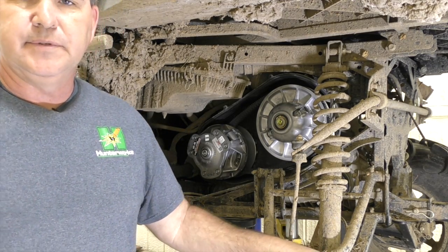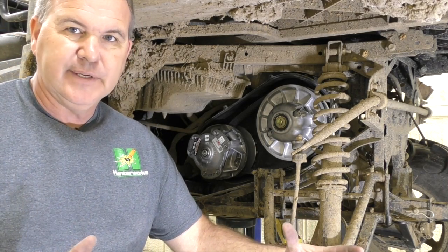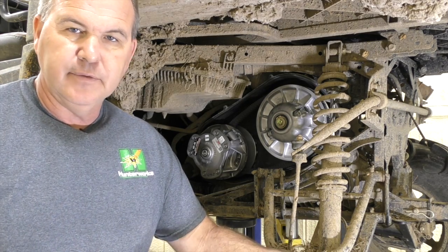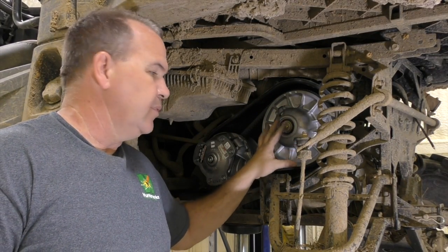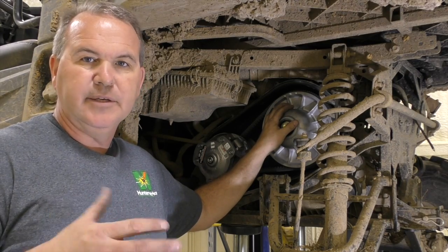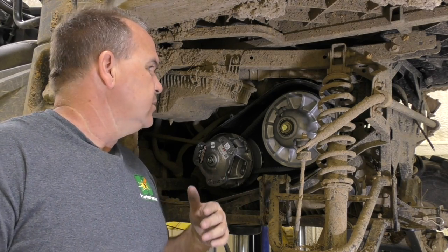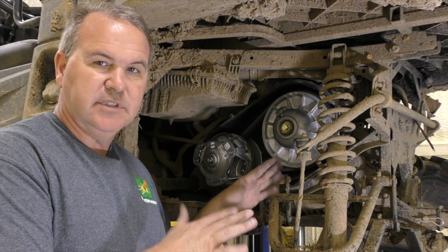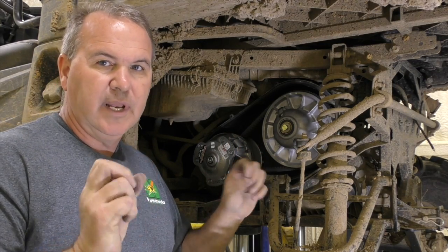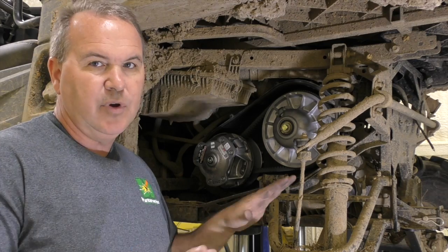For all intents and purposes, our Dura Clutch is on. We won't go through the entire process because it would be too lengthy. On the install portion, I put two of the shims on mine just as the instructions said, but after checking it I ended up taking both of those back out. This vehicle is kind of semi-abused and may have a true alignment problem that really needs deeper attention having to do with engine and transmission mounts, but it's so minor that I'm going to run it.